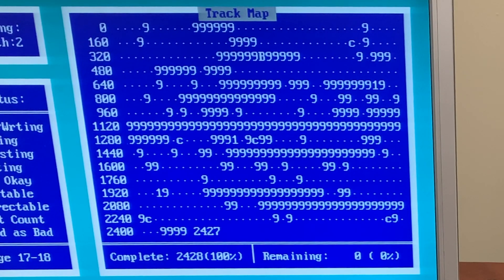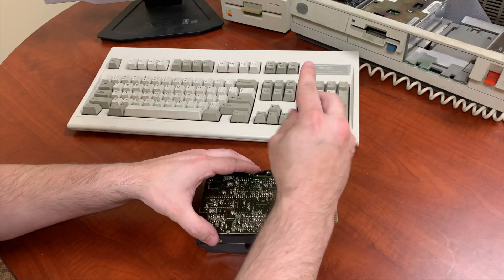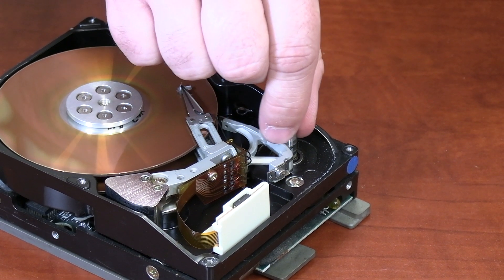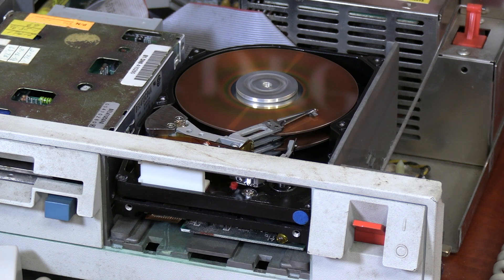Every other sector was a nine, which means nine or more errors — which is not what you want to see. We even tried swapping out boards with the first drive. We tried oiling the bearings and oiling the actual stepper motor that controls the head for the drive. That also didn't work. We couldn't bring that drive back, and ultimately after many tests it just mechanically wouldn't come up to speed.